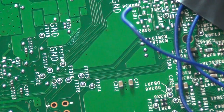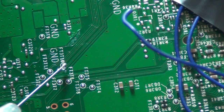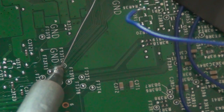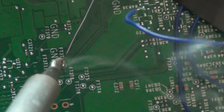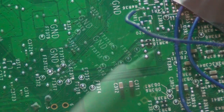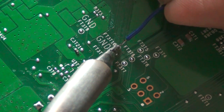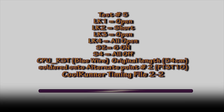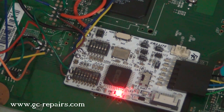That's the point ft3t10. Let's solder the wire onto this point — flux it and pre-tin it first. Now let's see if it glitches or if there are any improvements.